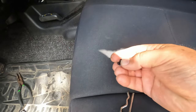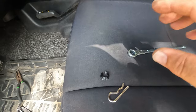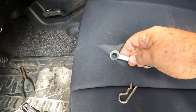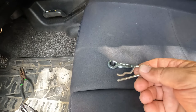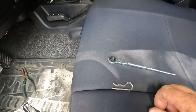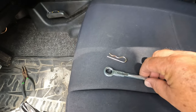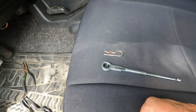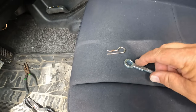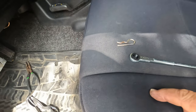I 3D printed me a bushing. I got to looking at the setup that they had using this pin right here, and they did have the plastic bushing still up in here even though the end of it was broken off — that holds it into place and I believe it will just keep it from rattling around. So I 3D printed me one, and this just sits right over the top of that and slides onto the clutch pedal. This clips onto the groove on the shaft that's on the clutch pedal and that will hold this in place permanently. I'm not going to use the piece of plastic that came with this — I want to save it in case I need it later. There's nothing here to fail, and that's what I like about this setup. I was impressed that the previous owner came up with that — it's a really good idea. You don't have to have this bushing; I just think it might jingle and rattle around without it. That's why I 3D printed one, but you could wrap it with electrical tape or anything, because I know most of you guys do not have a 3D printer.